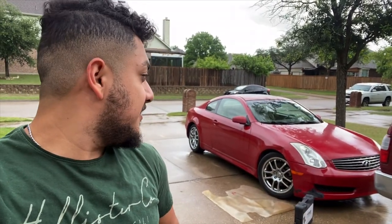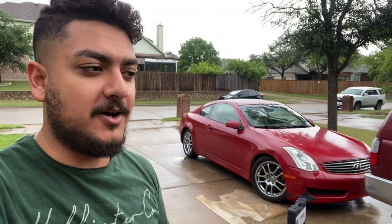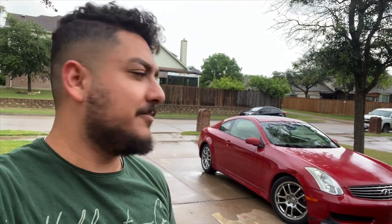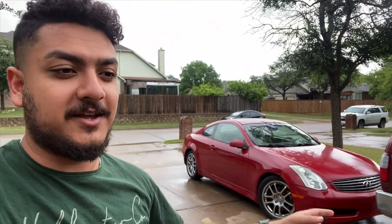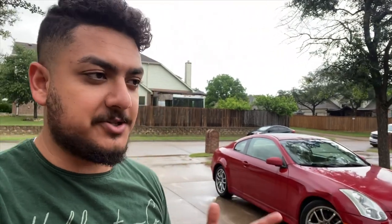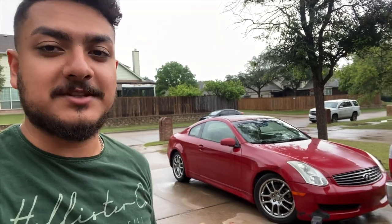Welcome back to Seize the Speed for another video. Today it's part two or three of our project G35. As you guys might know, if you have VQ cars of this era, the headlight ballast for the xenons go out pretty often. That's my speculation for the passenger side headlight, because neither the high beam or the low beam work. First time this happened to me it was on my 03Z - I went and changed bulbs a bunch of times before I realized it was something else. Let's get into it, I'll show you how to do it step by step.